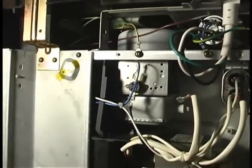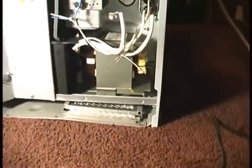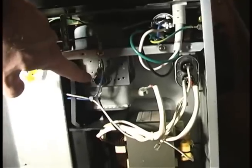Lots of times it's easier and cheaper to just buy a new microwave. Especially if it's a countertop microwave, it's just way cheaper to get a new one — just replace the whole microwave. Because you can get several hundred dollars in repair bills and not get a new microwave for $250. This customer actually got another microwave for $250. Had that part been available, it would have been $100 plus about $60 to replace it. Another item that's not too expensive to replace is this high temperature limit switch. If that burns out, it's about a three or four dollar part — I've replaced those before.